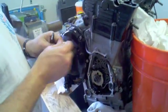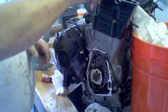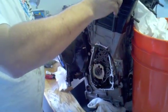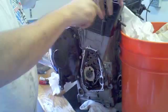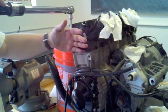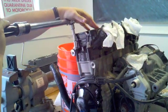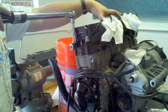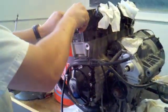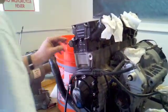To remove the head assembly, we've got two bolts on either side. On the right-hand side, these bolts are recessed along the engine case side — it's a little hard to get a socket on those, so I'm just going to use a standard Allen key. I've already pre-loosened these. We pull these right off and repeat the procedure on the other side. Now I've spun my motor around to the other side — here's the left-hand side. There are two cap bolts that hold the head on. You might find that you need a longer lever to get these loose, especially if the motor is out of frame. You'll need someone to hold the motor while you lever this over. With both of these loose, those should be the four mounting bolts, right and left, for the head. There are washers on here as well, which you'll want to pull off.